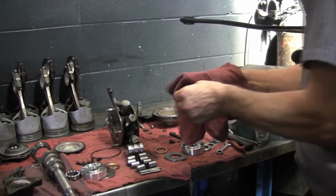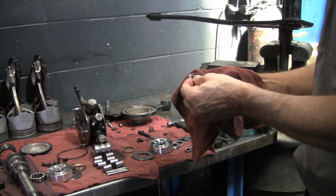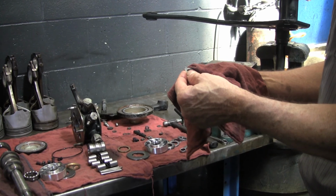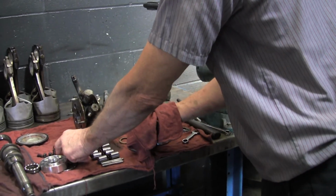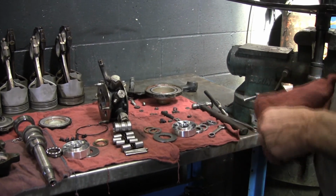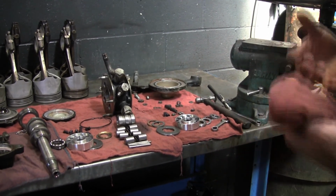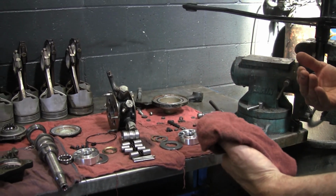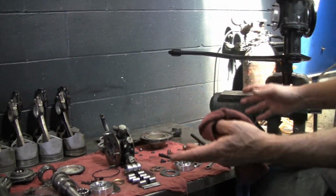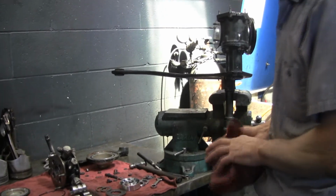Do those parts wear and need to be replaced? No, they don't normally need to be replaced. This should have a V4 on it also. The corresponding shim washers will have the same number as these tapered bronze washers. But always make sure when you take it apart that they do, because if I've worked on it before and had to center it, I will use other washers and they may not be numbered the same.